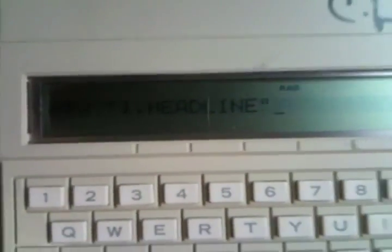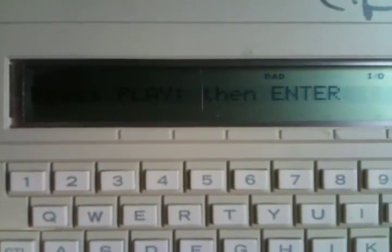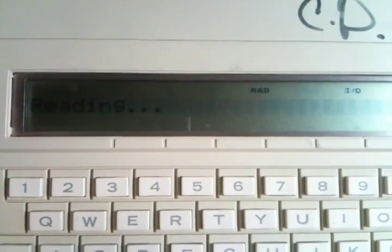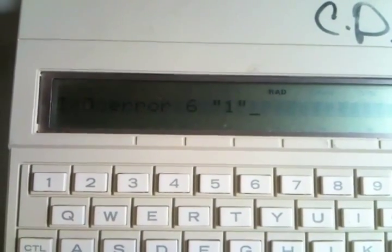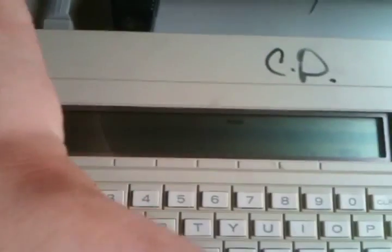We're going to plug the jack back in. The cassette is device number 1 — it took me a while to find that. We're going to load one dot, and load one dot Headline, which I think is what it calls itself. It'll say 'position tape, then press enter.' Press play, then press enter. It's going to sit there with the I/O on it. Hopefully it'll read without any issues. Oh yeah, I guess it didn't want to read — this thing's very picky about volume levels. So I'm just going to go ahead and load it off of the Quick Disk instead.